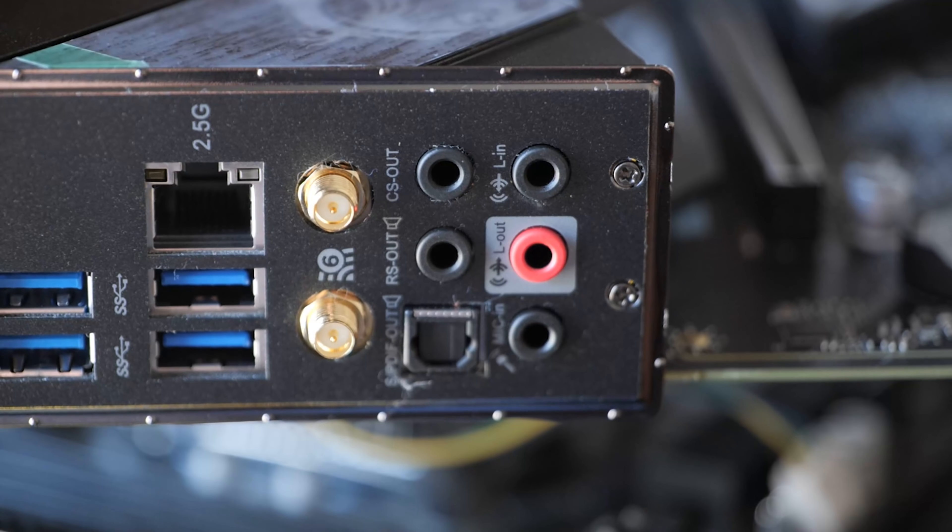After a failed benchmark attempt, for the CPU voltage override I set adaptive plus offset, left core voltage on auto, and added a small offset of +0.070V. Temperatures went up to 78–81°C — not in the danger zone — and stability improved significantly. In CPU-Z single thread we're now getting 580, about 80 points higher than stock, partly from the 5 GHz clock and partly from actual stability. Shadow of the Tomb Raider with this overclock: 166 FPS average, GPU-bound 38%, peak temps around 75–82°C.